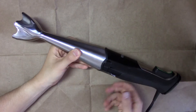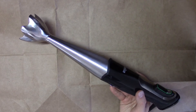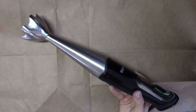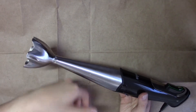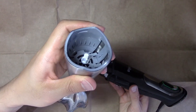There's a piece inside that connects the attachments to the black motor. When my friend brought it to me, it was actually cracked in half. So I went to Tinkercad and designed a replacement, and then graduated into Onshape to design and replace that part that you can see there.